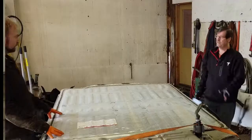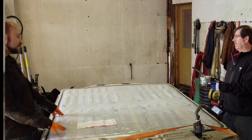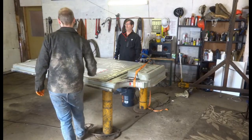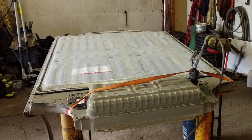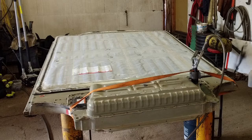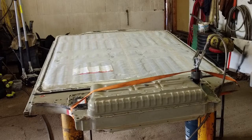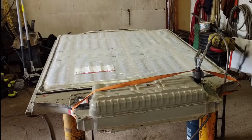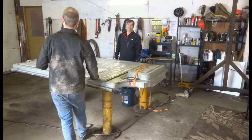Okay, so how did you decide the health of this then? Once I determined that it was accepting 72 kilowatt hours out of its 77.5 capacity, and that it displayed a maximum range of approximately 400 kilometers, you're just able to do some math and determine that that's under 10% degradation on its normal max capacity of 440 kilometers, or 77.5.